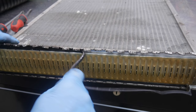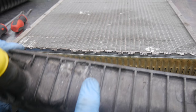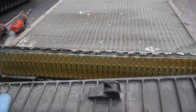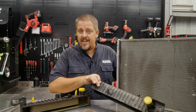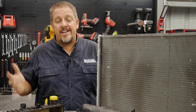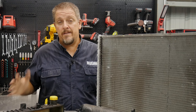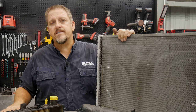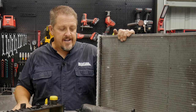As mentioned, no failure on the seal, no failure on the actual core itself — that looks very good. Just a failure on the plastic tank on one side. We'd already identified that when it was in the vehicle and we've already fixed it by replacing it. That's one of the catches in today's society — we don't really fix things. Twenty or thirty years ago we would actually core out the radiator, replace or solder a tank — with brass radiators and aluminum or even brass cores, things got fixed like that. Now we just replace them. Two hundred dollars and we had a brand-new radiator; a GM OEM one might be $360–$400. We're parts replacers nowadays.